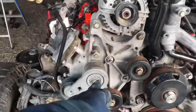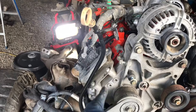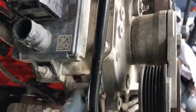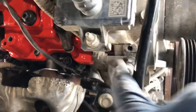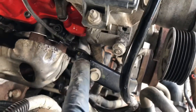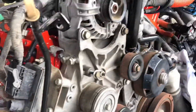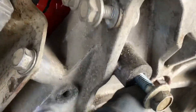And maybe an extra turbo — back on three bolts, torqued to 34 foot-pounds. The glow plug controller module is right there, worked up. Down on the bottom side, this little wire has a bracket that goes underneath this stud, and there's a little piece that goes on there yet. Then later on, the dipstick tube will attach to that.